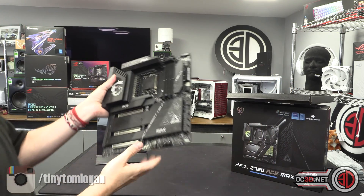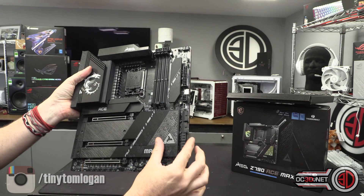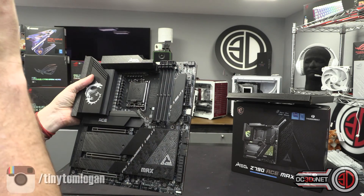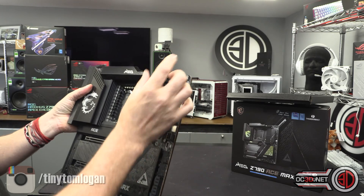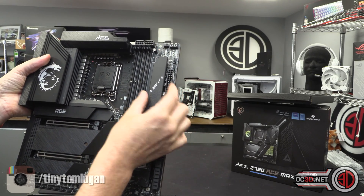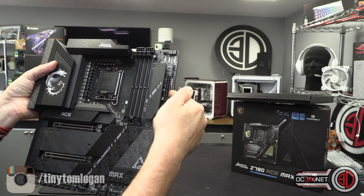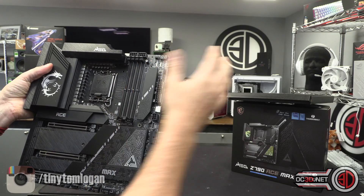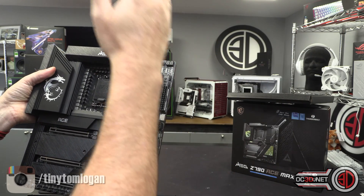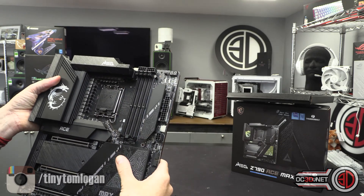The board itself — straight away, it's big. XL-ATX, there's a little bit of extra width. A lot of people will instantly start asking will it fit my case. It's just that little bit wider, so look at your case — it might cover up one of the grommets for your 24-pin cable. Some cases have two lots of grommets; some might have to come in from a different place. That's the only thing you've got to think about: where your grommets are and where they're going to pass through.